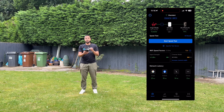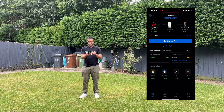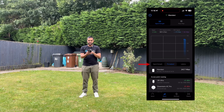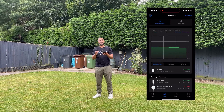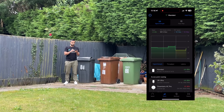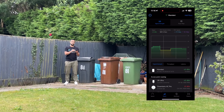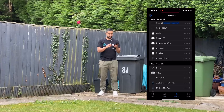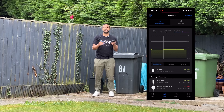On screen you can see we have the UK Ultra and we're connected to it outside — I'm probably about five meters away at this point. You can see the latency and the Wi-Fi signal is minus 59 dBm. Down the back of the garden at approximately 10 to 12 meters away, we switch down to around minus 64 dBm, and if I was moving around you'd see a little drop to minus 70. Looking at the throughput, I'm still getting around 120 to 150 Mbps, and the latency is still around 18 milliseconds.